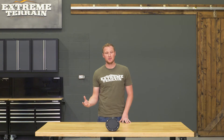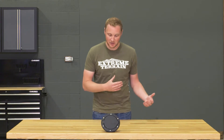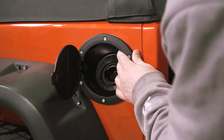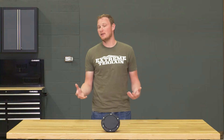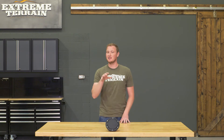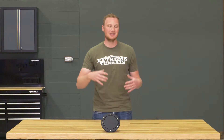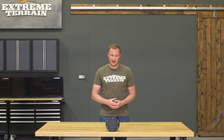This is going to be a one-piece fuel door, so a lot of the other fuel doors on the market are just the door section, and you screw that into the fuel fill surround. This one actually includes the fuel fill surround, and you replace that entire piece with this new one. The benefit of that is a slightly easier installation, no need to drill anything, and the fact that this is completely reversible because you have a completely intact fuel filler surround that you can very easily pop in and remove if you ever decided to go back to factory.